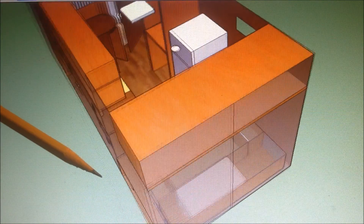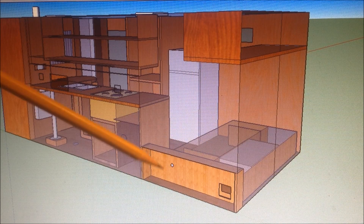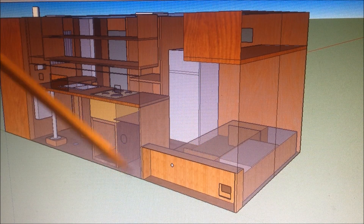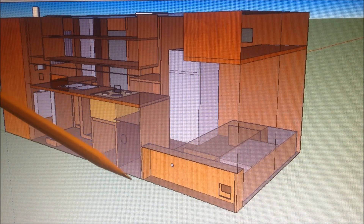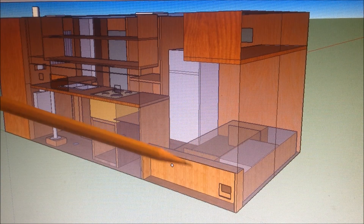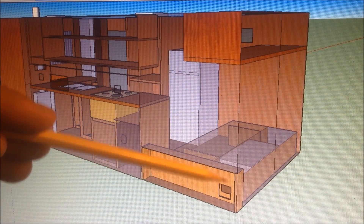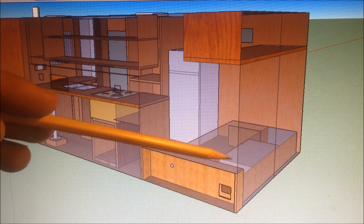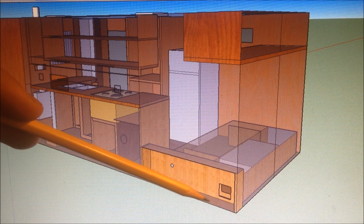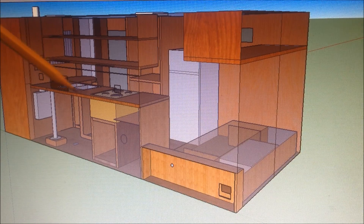That 30-gallon water tank was going to be here when I had the other style bed, so I put this water inlet right here. But since I changed the bed style, I had to enclose this water line somehow, so I made this little shelf unit — I thought you could put a TV up on top there. The water line will come down through underneath the bed into the water tank, and that will be the supply line. We'll have a return line coming out, and there's going to be a pump right here as well, pumping water to the hot water heater and also the cold water for the sink and the shower.